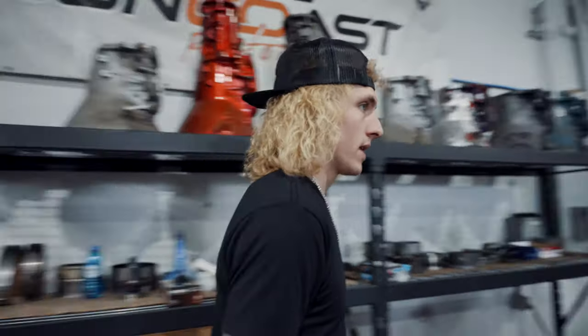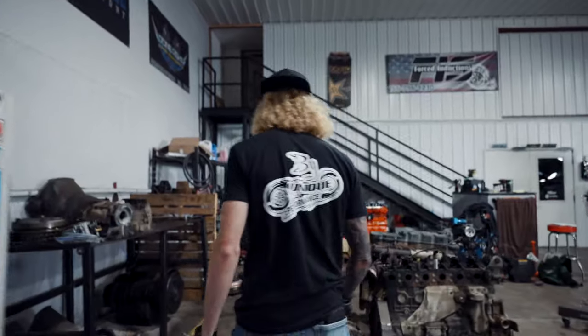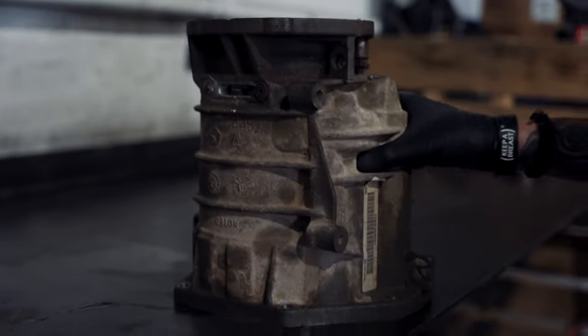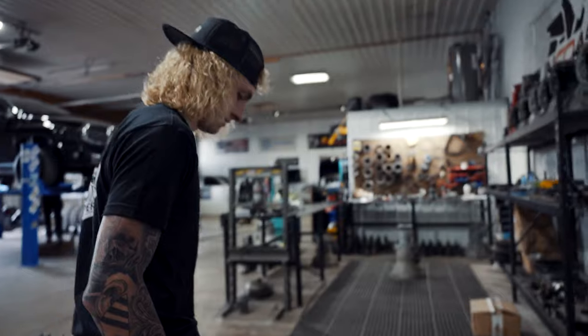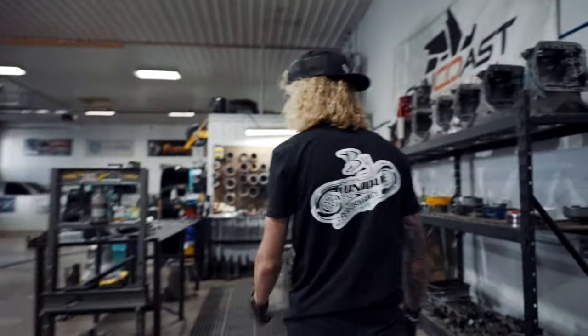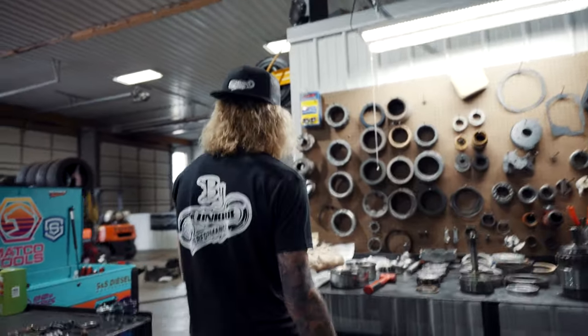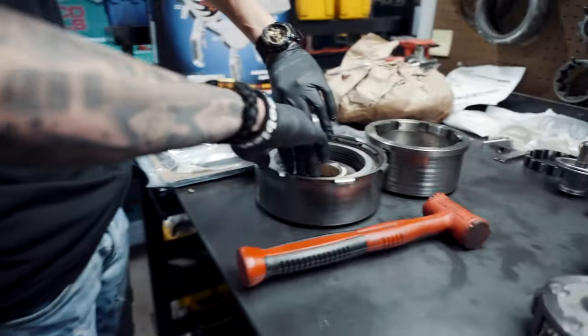The clutches were actually really bad in this yesterday. I think they took the trash out. This is mine. It's not very good. But anyways, it didn't look very good. The forwards and directs were burned out. It was trashed at 70,000 miles. I don't know why, but man, drove the truck like a man. So we got our direct drum assembly done today.